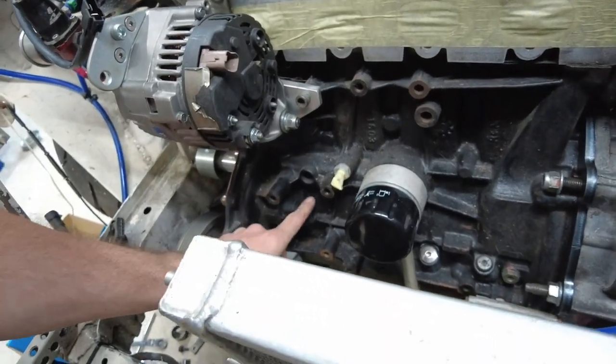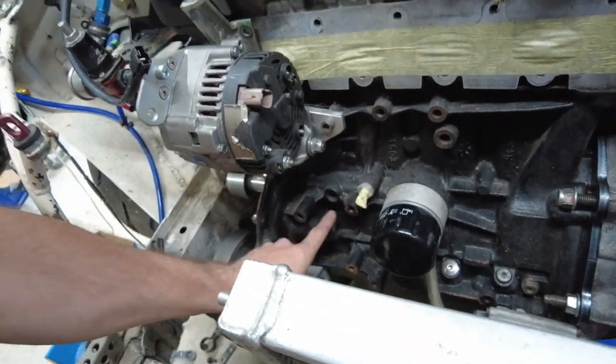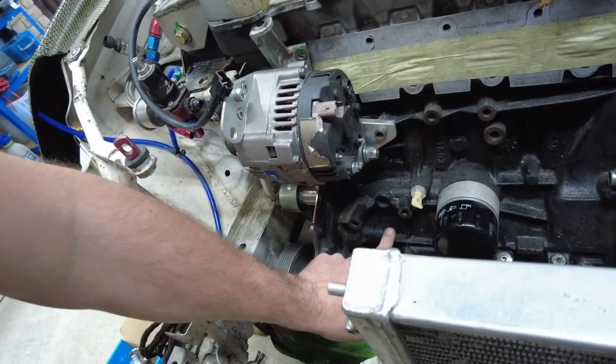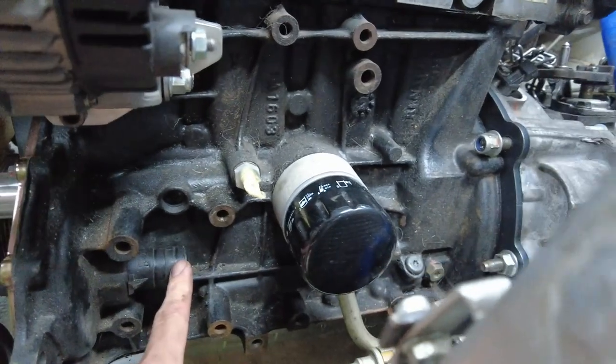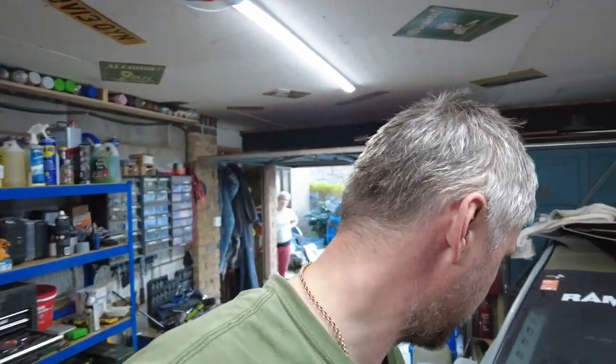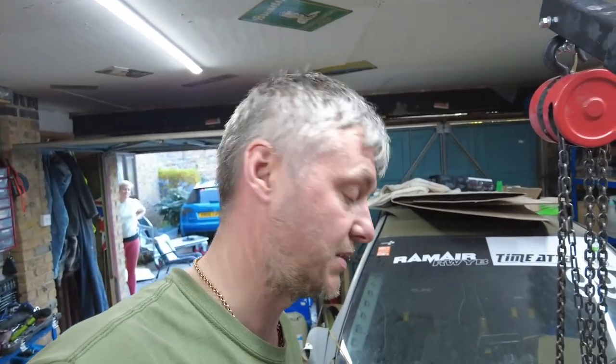You might notice this fitting has been cut before — I just took it out and put it on the lathe. Nice to have a lathe — I made a little groove so it doesn't come off. Now I just need to wait for the 90-degree hose, then I'll make a small bracket so the pump isn't wobbling around and secure it in place.